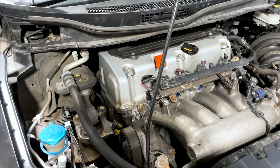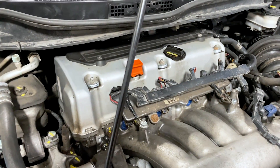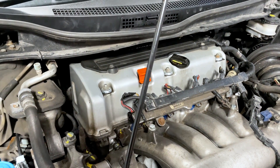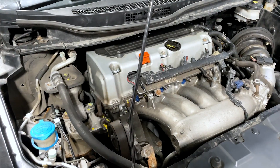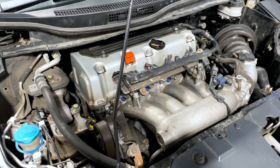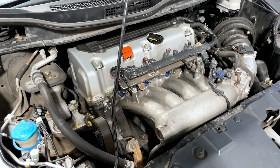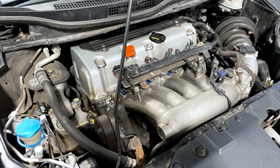When you do this, you do have to modify the head. You have to weld part of it and then machine it flat. You also have to use the original K24 Z7 valve cover and timing cover. I've tuned a few of these setups and it is a great upgrade. When this car was here before, we tuned it — it had very basic bolt-on so it didn't make crazy power, but today it made some really good power.